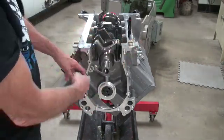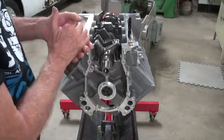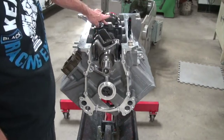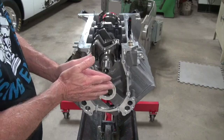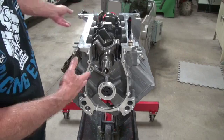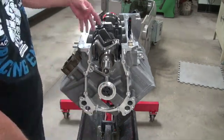The reason I didn't put the galley plugs in first is I had two helpers and I wanted to get some use out of them - they were going to do the heavy lifting on the crank and hammering on the caps. That worked out great. I knocked down the center main, tapped the crank back and forth to make sure the thrust bearing was seated good, then tightened it up and checked the thrust. I had to put a piece on here so the dial indicator had some metal to sit on. The thrust is five thousandths, which is perfect between the two and seven spec.